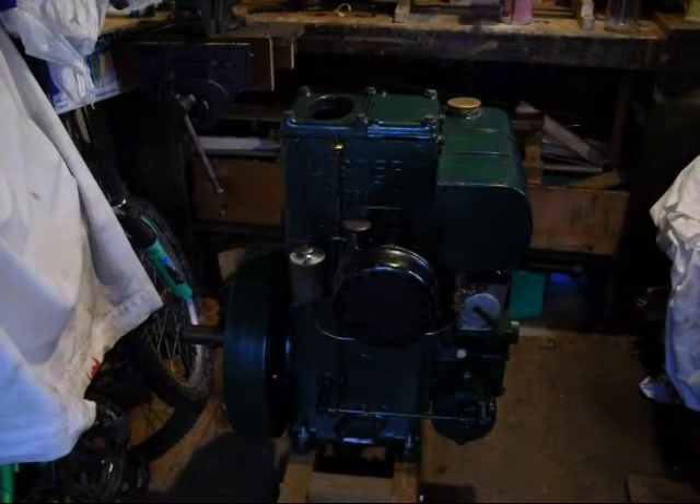Afternoon all. This series of videos is going to be dedicated to the top end rebuild of a Lister D-Type. I'm going to try and show you how to do it, things to watch out for. We're going to do a decoke on the engine, clean out the valve grind. It'll involve removing the valves and rockers. We'll be taking the cylinder head off and changing the head gasket, as it's just started to leak when running a load on the dynamo. I hope you enjoy these and find them useful.